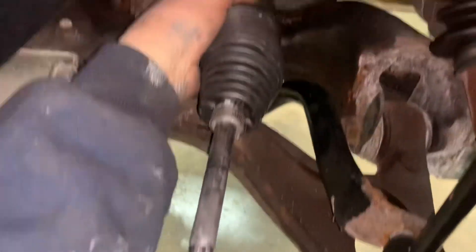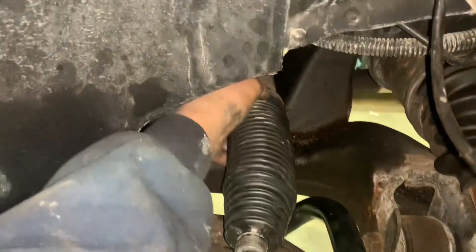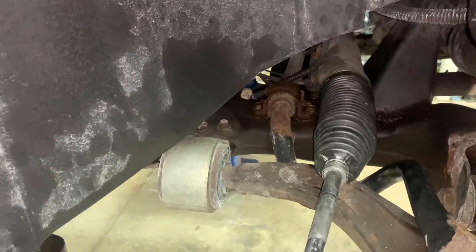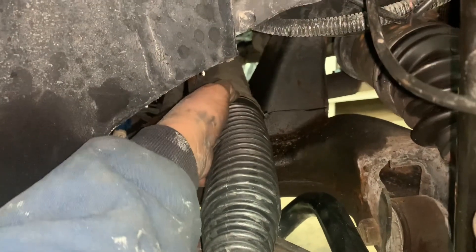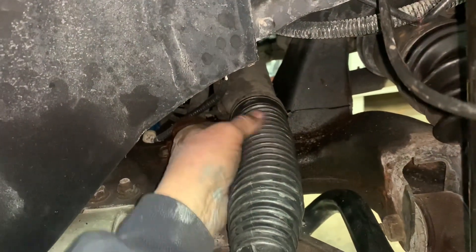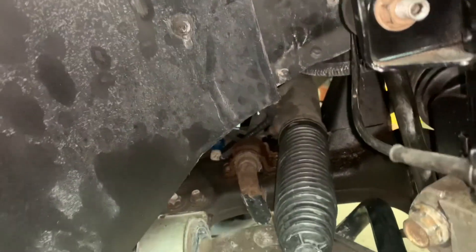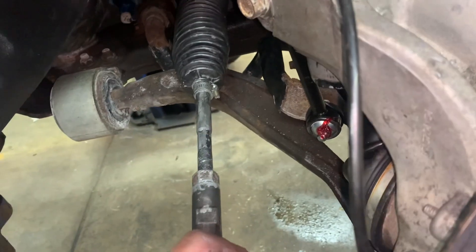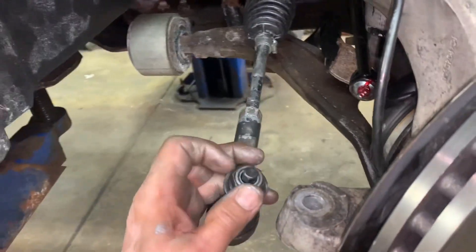Push your boot over there and get it down in place. Get yourself a nice zip tie — not a monster zip tie, just a regular one, like 3/16ths. Make sure you get that zip tie into the groove on the rack, not over the edge — make sure it's in that groove. Pull the boot out onto that little notch and tighten your clamp up. Then put your tie rod into the knuckle and tighten it up. Put your tire on and tighten your lug nuts to 100 foot-pounds and you're done. Do the same thing to the other side and you'll have all your tie rod ends done.